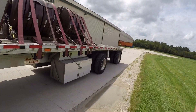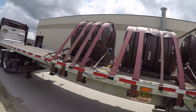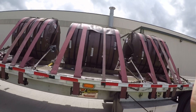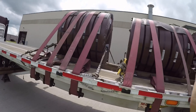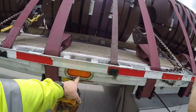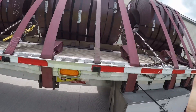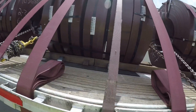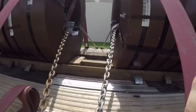How many securements do I have left? One — one four-inch strap, all I've got left. Two chains X'd through the eye of each section of coils: the middle section's got five, the rear section has four, the front section has four. Then I put a strap over each segment, or as many as will fit. I can't put one right here by my light, and I'm out of inches on both sides, so I used a two-inch right here.